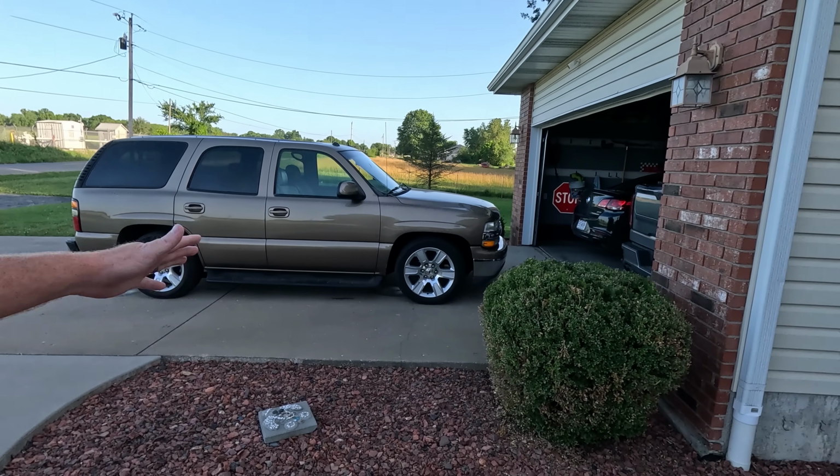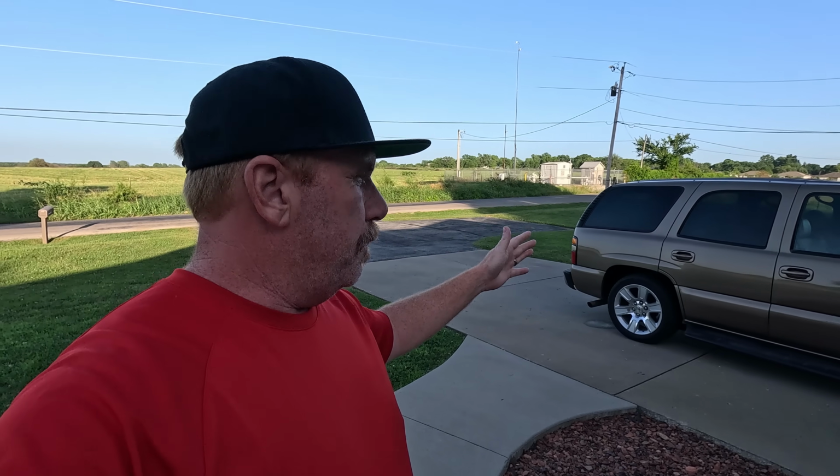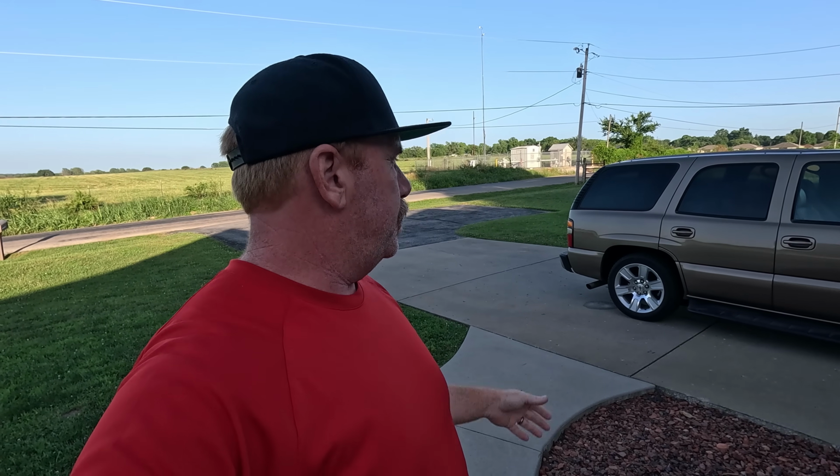But anyway, we started out with the torsion bar drop. I used some 3/4 ton keys out of that dually that we put together I still had. I bought 2-inch drop spindles and got the front down and put Belltech shocks on it. Then we went to the back. I did a Belltech shock and a Belltech spring. It's a street performance shock.